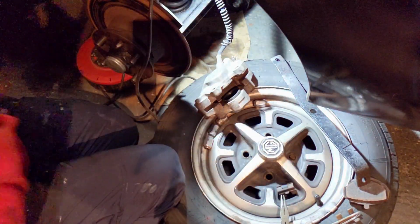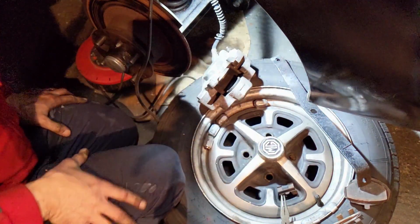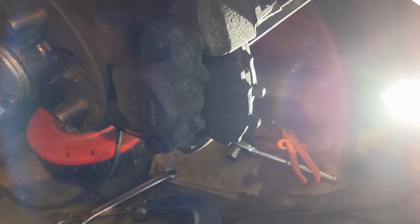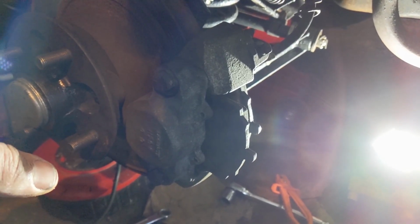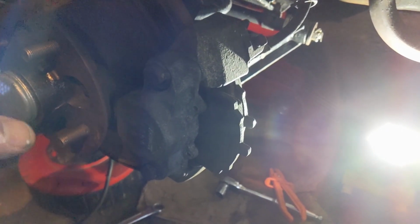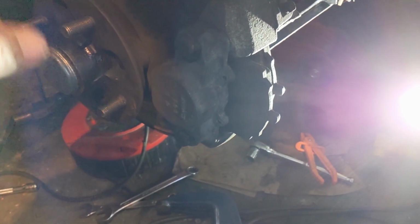So we've got them back to roughly even distance. So I'm going to try both. I'm going to put it back together and see if we get anywhere. A frustrating day. So I can't get the pistons far enough apart to get the pads back in, and I don't have a disc brake splitter, pusher, so I'm going to order one and go from there.